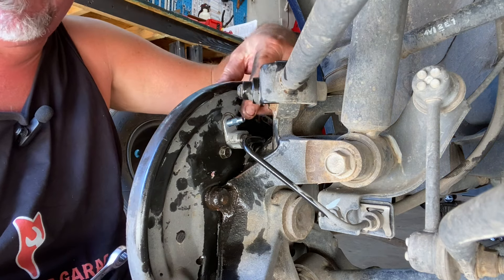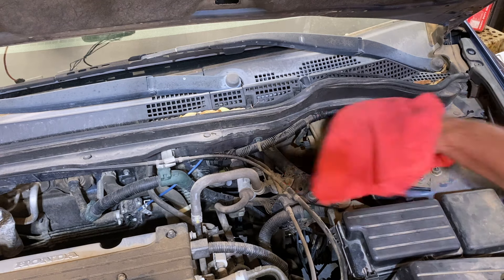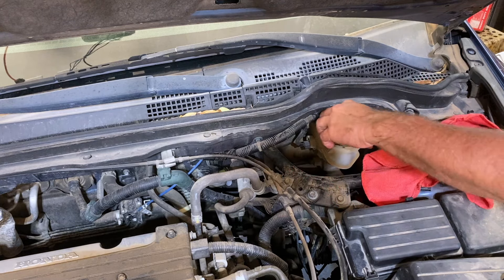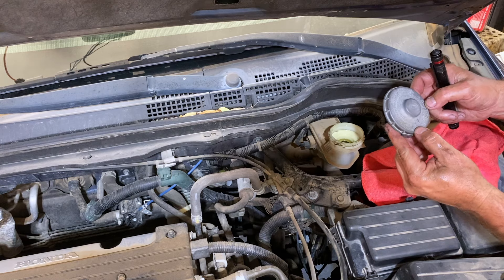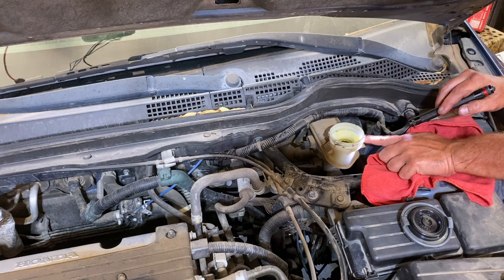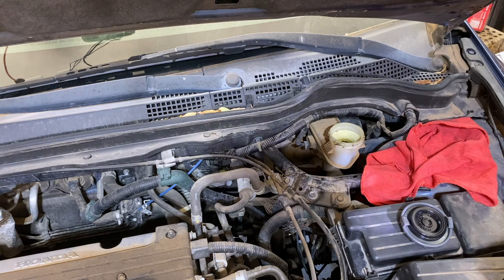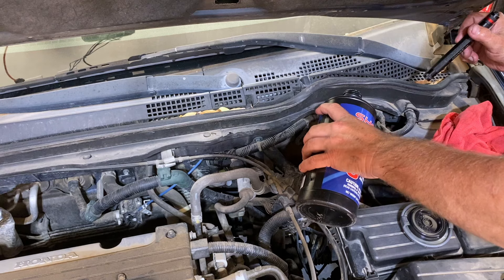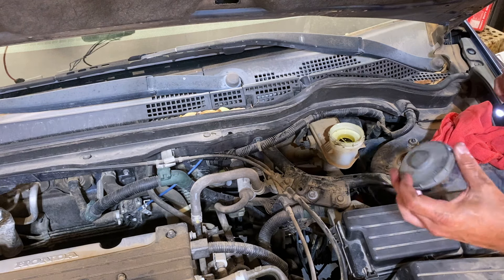Now what you're going to do is bleed it, and that's what this nipple right here is for. This is how you bleed the brakes on your Honda — and really just about any vehicle. For us we're doing this on the 2005 Honda Accord. Take a rag, pull off the reservoir cap, read it — this is DOT 3 or DOT 4. We have DOT 3 brake fluid. Take a look and find where your maximum line is — on this vehicle it's right here. We are a little low, so just take brake fluid and get it in there up to the max line. Now put the cap back on.